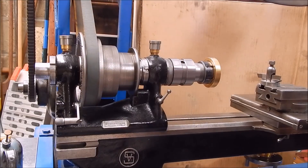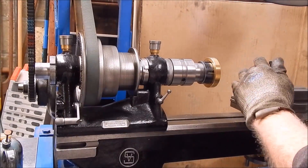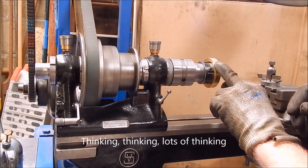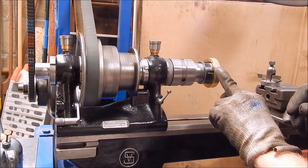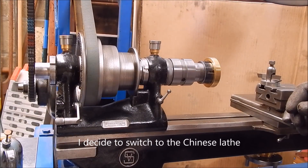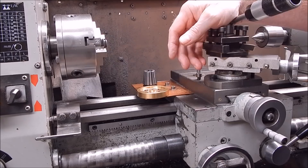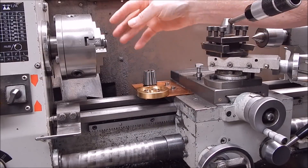So it's just the centre that's no good. I'll just dress that and take that mark off. I should really use a shear tool on that. This is a classic example of where a set of collets is basically worth its weight in gold — it can do these jobs very easily, because without collets you wouldn't be able to grip this without marking it in a normal three or four jaw chuck.